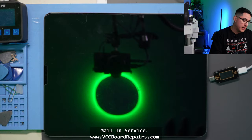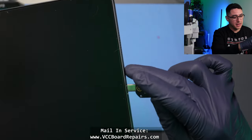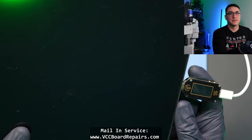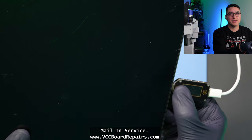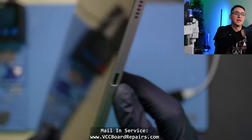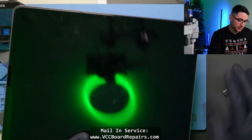The first thing we've got to do is check out what's going on with this iPad. I can sometimes get the charging symbol to show up if I wiggle the cable at certain angles — that typically tells you if it's the port, though not always. This is a newer iPad Pro that has USB-C, so there's a high chance the port is damaged. We see a ton of these at our shop.